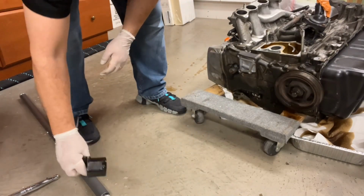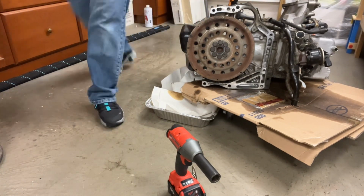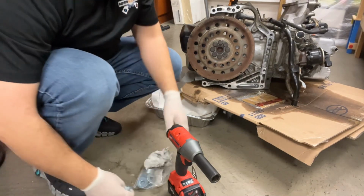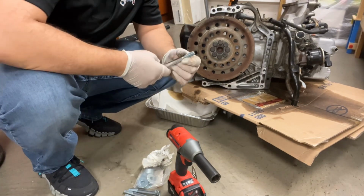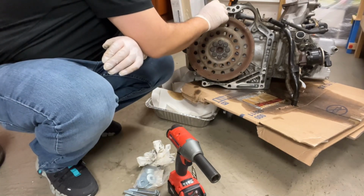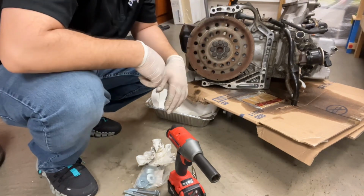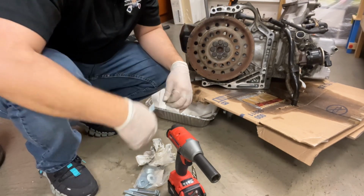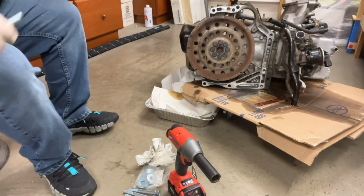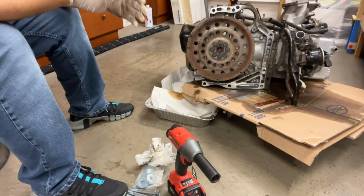Okay, now we can put it on the stand. And we have 90 and we have 100 millimeter bolts. Okay, they're M12s and they're 1.25. The thread's 1.25. Okay, so we'll see how they go on the stand. Probably easier to get the stand piece to put it here instead of mounting everything on the stand.